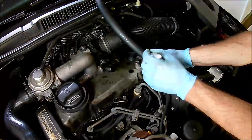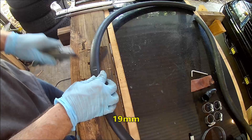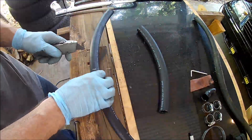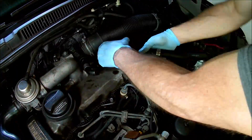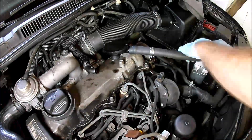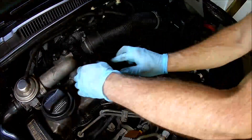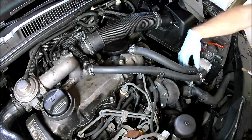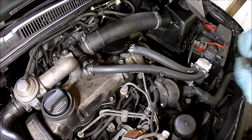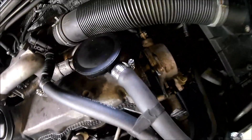Okay, we're almost done. I just need to install the hoses. I bought 3 feet of vacuum hose from the local auto parts store — it's 3/4 inch inside diameter. I test fitted the hose and marked where it needed to be cut, then installed the hoses and clamps. Last but not least, I used a velcro tie to tidy up the hoses. One of them was really close to an engine cover mount and I didn't want the hose rubbing on it. And that's it — mission accomplished.